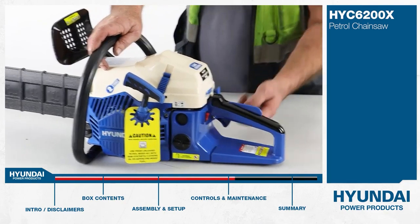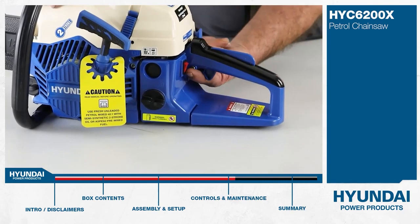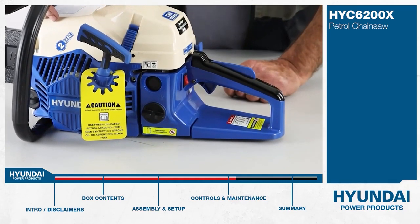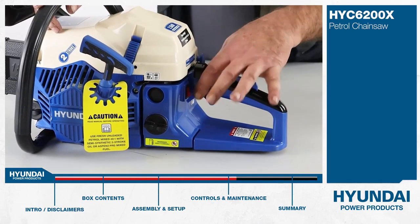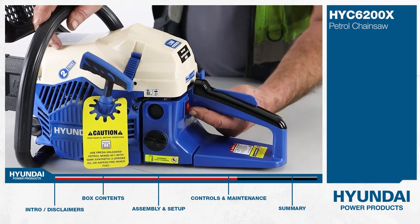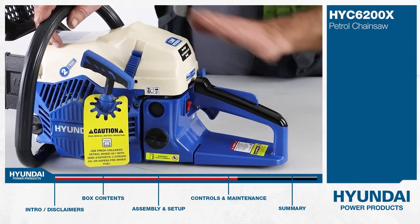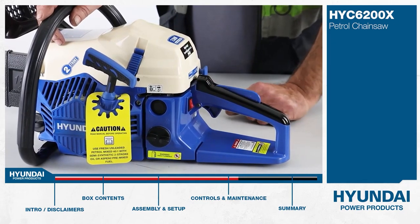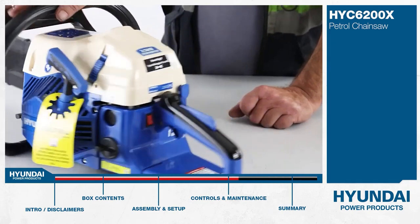Next to this we have the on-off switch. As you can see, I've got it pushed down here. That's the off position. That would be the on position. So all this switch does is enable the machine to have a spark. If I push it down there, it kills the spark, the engine will stop, and it also will not start. So we would need it in that position to start.